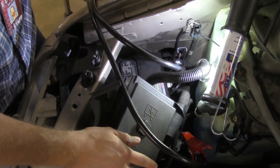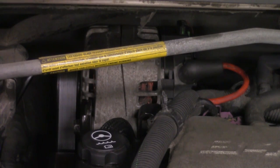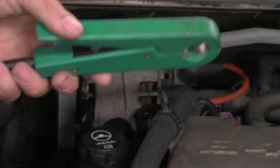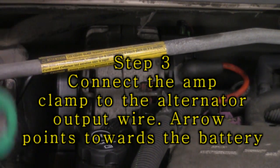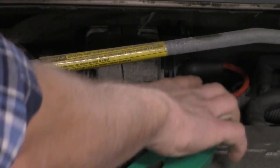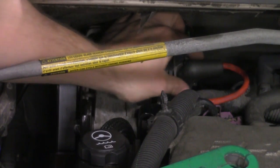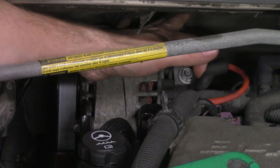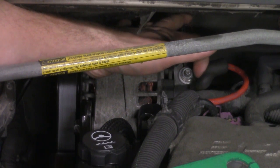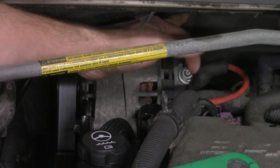Both of our leads are now connected to our battery. Now I'm going to take my amp clamp — this green inductive clamp from the VAT40 — which has an arrow on it, and I'm going to try to clamp it around the output wire of the alternator. My alternator is all the way back here. My output wire is this large red lead. You can commonly identify the output wire as a large or heavy-gauge wire — one of the thicker wires, largest in diameter. If you move the boot back, you'll notice the alternator's output wire is typically held in place by an electrical lug stud with a nut on it, so it's real easy to find as long as you have good access to the alternator.